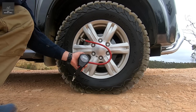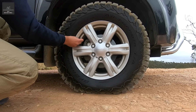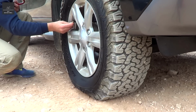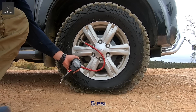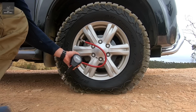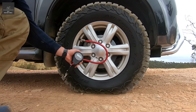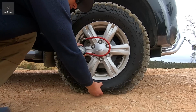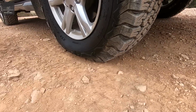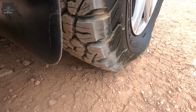We're going to go down to 5 PSI as our last pressure and see what that looks like. Now we're at about 5 or 6 PSI, and you'll notice the pressure isn't even registering on our inflation gauge. This is an emergency pressure, as mentioned before, on the beach, and you'd want to keep your wheels dead straight when running pressures like this. You can see there's quite a bit of bulge in the track width, which also makes it susceptible to sharp rocks hitting it and puncturing it. So you'd want a good strong tyre like this, a light truck tyre, to try and avoid any punctures.